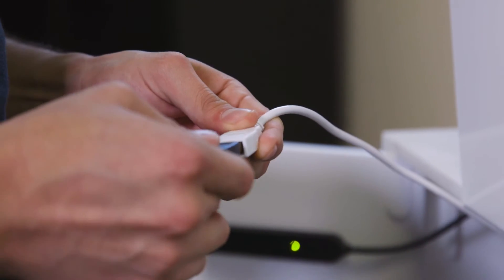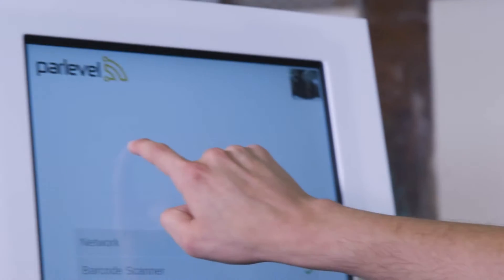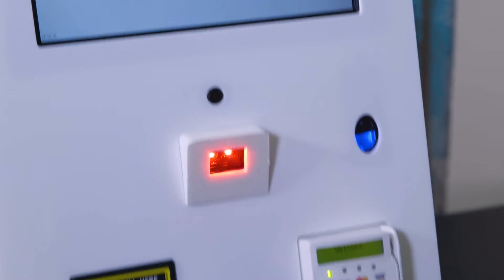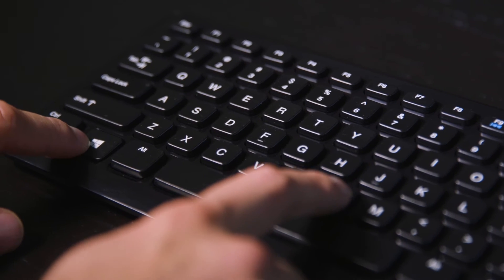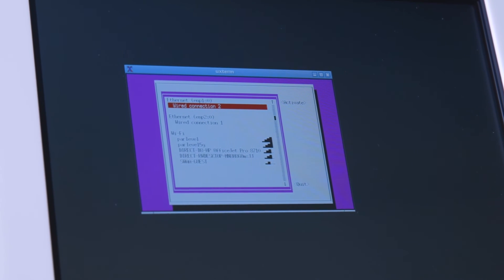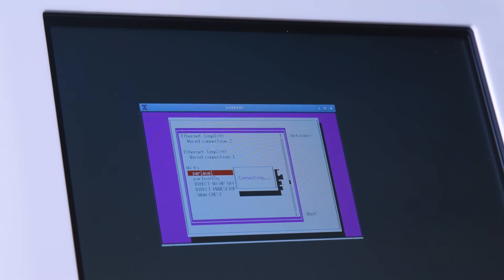If the kiosk will be connected through WiFi, plug the USB keyboard into the USB port inside the kiosk cabinet. After connecting the keyboard, touch anywhere on the kiosk screen to ensure it's in focus. Press Control+Q to quit the kiosk application. Afterwards, press Windows key plus N to open the network manager. Navigate to WiFi, select activated connection, select the intended network, insert the password, and press Enter.